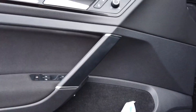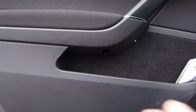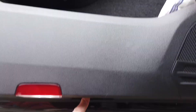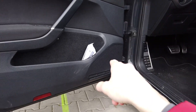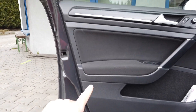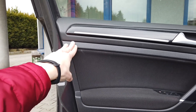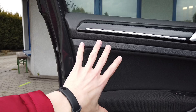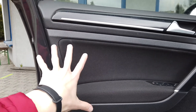The first thing you need to do is remove this cover — pry it from here. There's a screw here, a second one here, and a plastic lock that you need to turn 90 degrees either side. After that there are some clips: three clips on the side of the car and two clips here. I thought there was an additional one here but this sixth point is not a clip like all the others — it's something different.